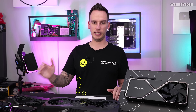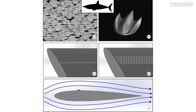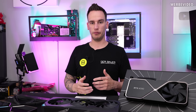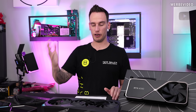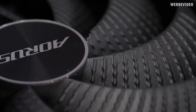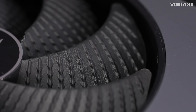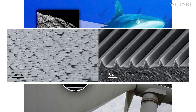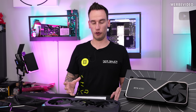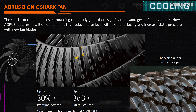For an airplane, the decrease in resistance is about 1%. If you read up on wind turbines, they achieve improvements of about 3 to 5% at best — and that's for having the entire surface wrapped. Now if you check the fans of the Gigabyte card, I'm not even quite sure if they can really make use of this Riblet effect. But if we zoom in on a highly magnified image to check out what the AeroShark foil is actually doing, you will see it's just straight, very sharp lines to decrease turbulent flow and increase laminar flow. The Gigabyte diagram showing arrows indicates higher turbulent flow, which just wouldn't make any kind of sense. I'm not quite sure if this would help at all — and certainly not 30%, maybe 3% at best.